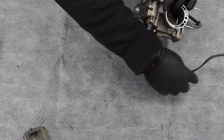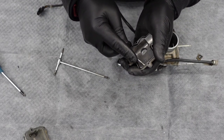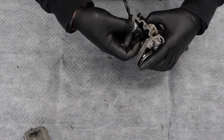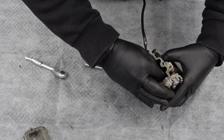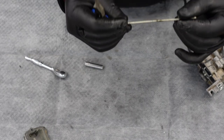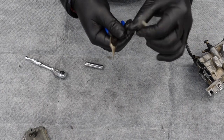So before we go in and clean these up thoroughly, I'm going to pull out the slide here. We'll remove this O-ring - all carb kits come with a new one. Pull that out of there. That should come up with your needle just like that. It actually kind of looks like it's worn a little bit - you can see some wear marks on there. Let's check to see if our new carb rebuild kit comes with a new needle.